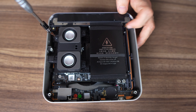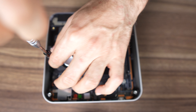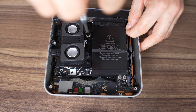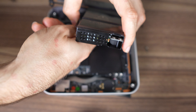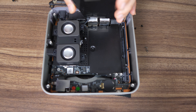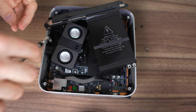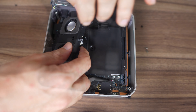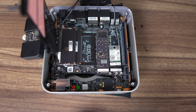To get to the memory and storage, the speaker and power supply need to be removed — they have cables and ribbons attached, so be careful and keep track of your screws, as different ones are used all over the place. Four screws for the speaker, then four screws for the power supply — wrestle them out. For the power supply, you'll need to lift the attached cable, then remove the middle plate with three screws. You also need to remove one hex standoff, then wrestle with the plate to get it loose.